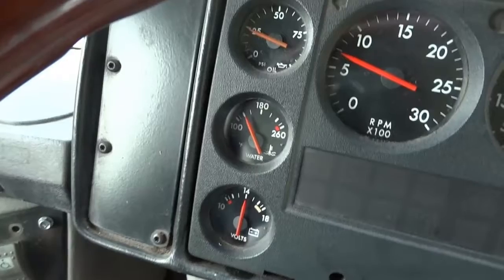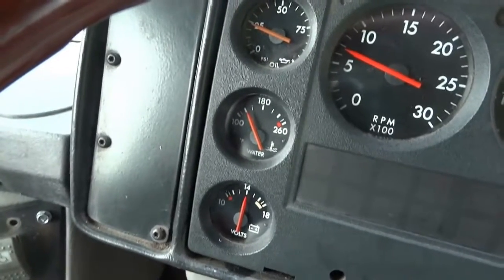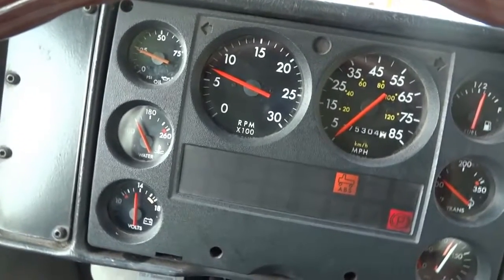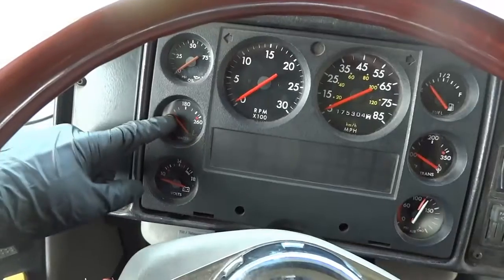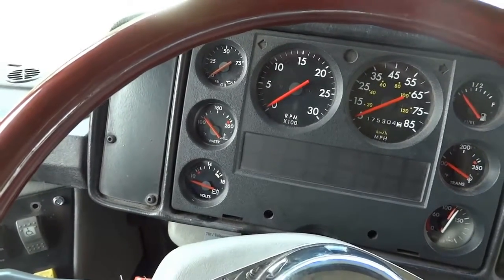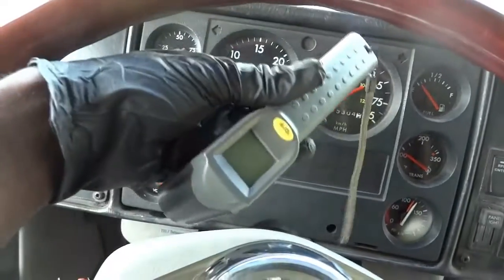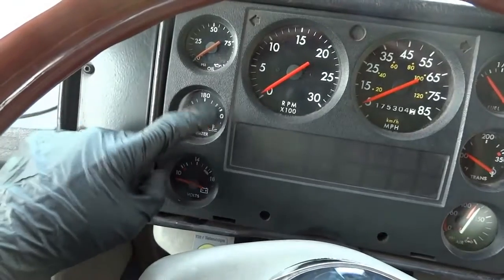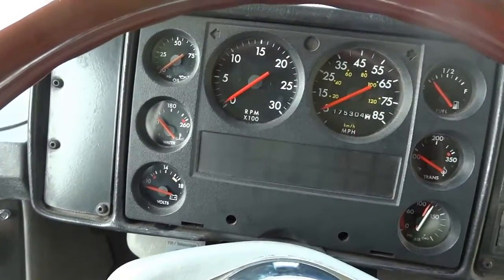I don't see the need to take you on a test drive — I feel comfortable with the readings I'm getting. The issue was just the defective temperature sensors. Our temperature sensors were bad. So to summarize: we had a hard start and the temperature gauge was intermittently reading high. The problem was bad engine coolant temperature sensors. The way I confirmed it was by going under the hood and using a thermometer — the engine was reading 260 on the dash but the actual engine was a lot cooler. And when I disconnected the sensors, the temperature gauge came down, confirming the sensors were bad.